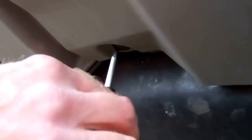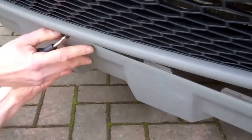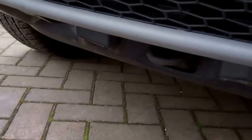Looking under the car, you can see the fixings. The slot runs front to back in the direction you'd drive the car. To unlock it, turn it so it's side to side. Do the same on the other one. Then it literally just pops down — you've got to pop it down first, and then these little tongues are located up under the bumper. That's the old one removed.